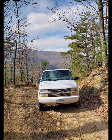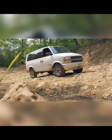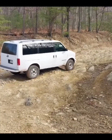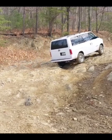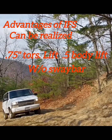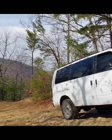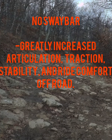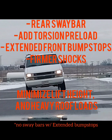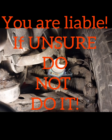Let's watch Large Marge make his hill climb, both with and without a front sway bar. Four big things to take notice of: most notable is lifting of the front tire, we also lose traction when the rear tire gets overloaded, and just how stiff the whole van looks. There's another view of the same thing from the back — we break traction, so we still make it. But now without the sway bar, you'll notice we don't lift the tire, we don't break traction, and our overall speed can be higher because it's just much more comfortable and less stiff feeling. Increased articulation and improved ride on rough terrain are the two big advantages. But highway handling and liability should always be considered first. By implementing these modifications, negative effects can be minimized. This connectable sway bar link may give you the best of both worlds, and the original end link can be taken out for testing easily enough — just be sure that you and any other driver of the van is comfortable with how it handles.